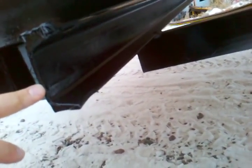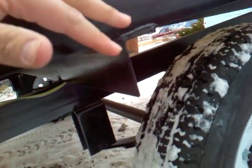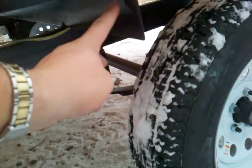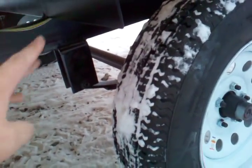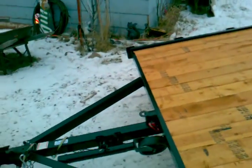It's got 3/16 thick cross members as well, and it's channel on the hinge point — three hinge points total. It's got an 8-foot channel subframe underneath, and that's what keeps the trailer from bowing. A lot of times pressure comes up from the wheel mount and if you're just welded under the cross member without a subframe, it'll push up through the center of the deck. We use a full 8-foot subframe that goes all the way back and supports that axle.